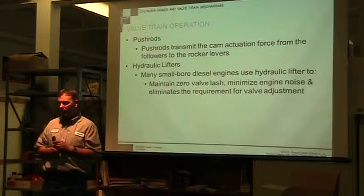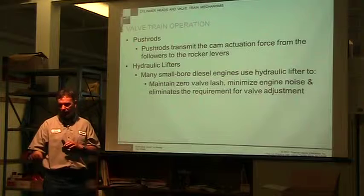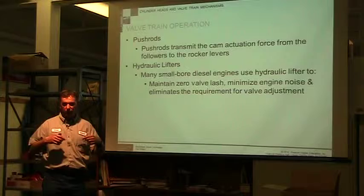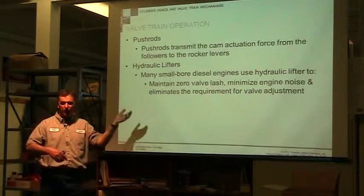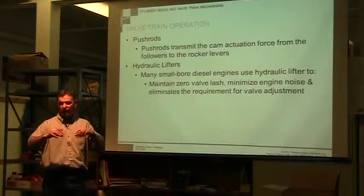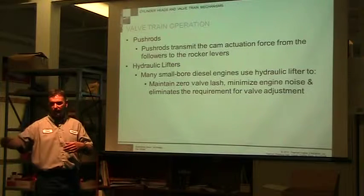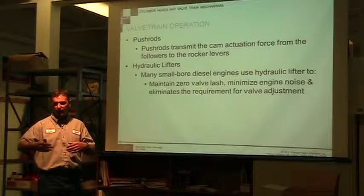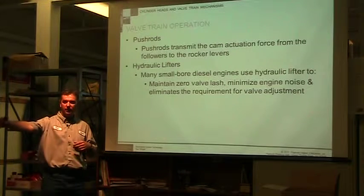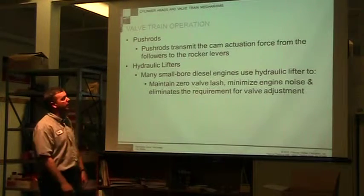The way to check a push rod to see if it's round is to get a level surface like a tabletop or a floor and just push the rod across it. You lay it down flat and push on it, and it'll just roll across. If one end is bigger, it'll roll in an arc. If there's any kind of bend in that rod at all, it'll go vroom, vroom, vroom, vroom. It'll be kind of jerky, and it'll stop and rock. So it's really easy to lay them on there, flick it, and it should roll across the table and stop. If it jerks, they're bent. So it's pretty easy to check.